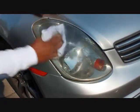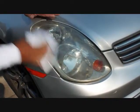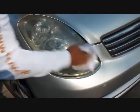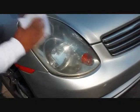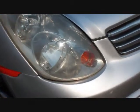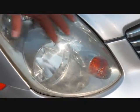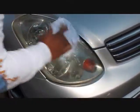It's definitely starting to break down — in fact it's almost all off in here. Still not great on the sides, which is where we had our issues on the other lens as well — on the edges. I'm not sure why that is, but whatever was on here before was apparently applied heavier on the edges of this lens. We'll just keep giving this a shot. There's still real cloudiness right in this area, but up here where we had some before it's definitely gone.